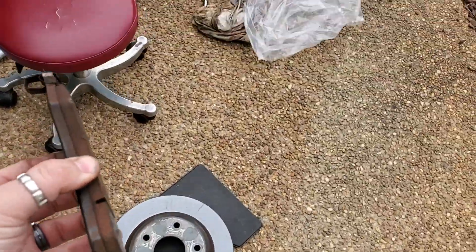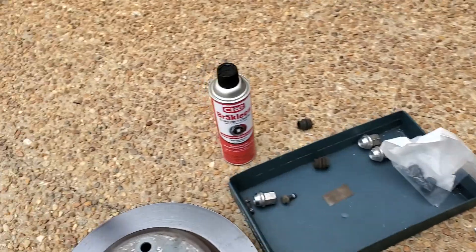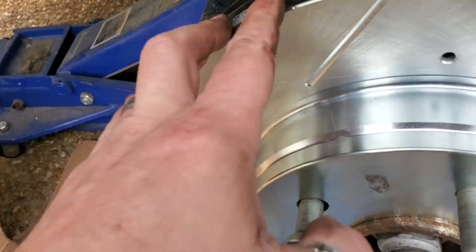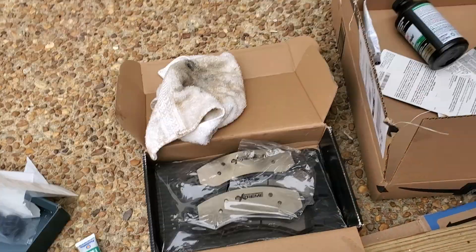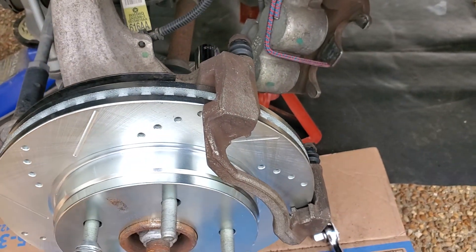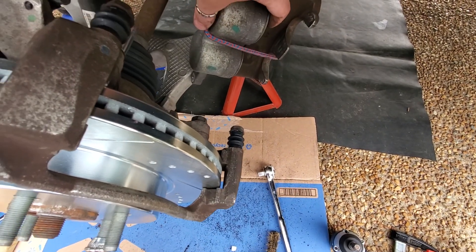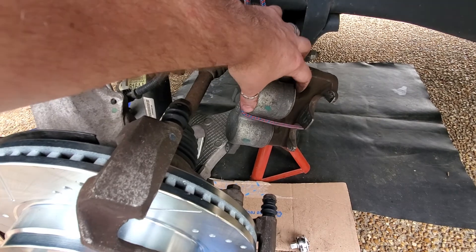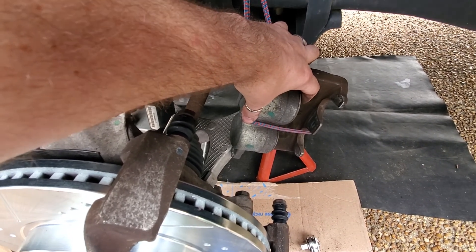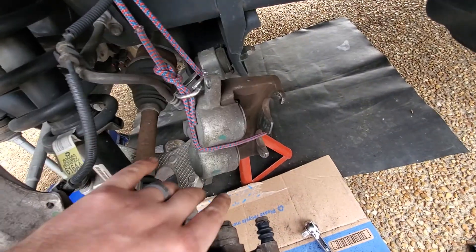So this is the old pad, and it wasn't totally worn out — it was squeaking a little bit. And I went with an upgrade since I tow; I wanted something that will better stop. So this right here rubs along like that. So what we do is we replace the rotor — that's this thing right here — and the brake pads; those are my new brake pads. So this caliper — this piston right here — there is hydraulic fluid inside of the truck. When I hit the brakes, this fluid — and fluids can't compress. Gas compresses easily, but that fluid won't compress. It pushes these pistons out, and they push two brake pads against this rotor.